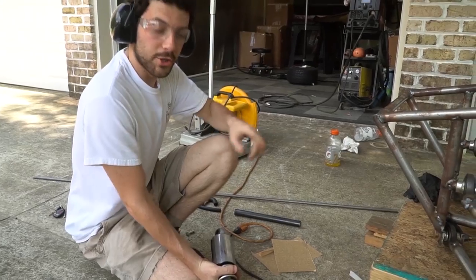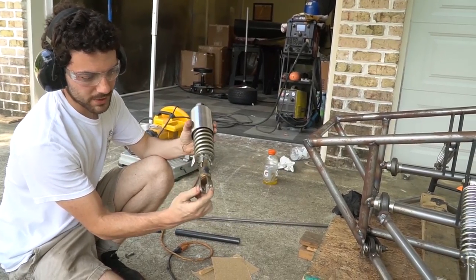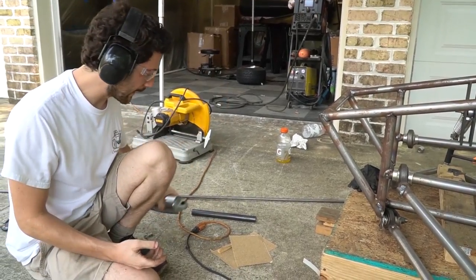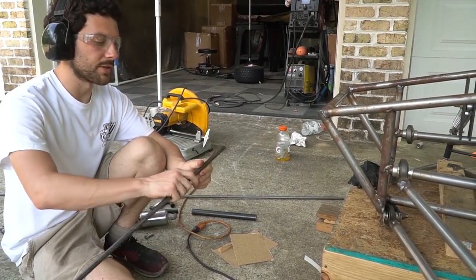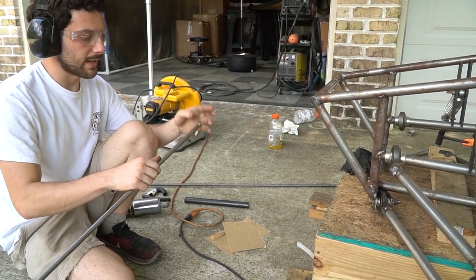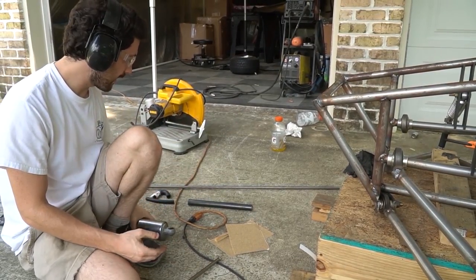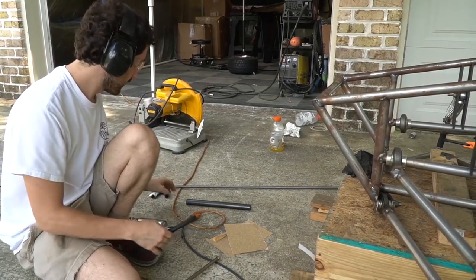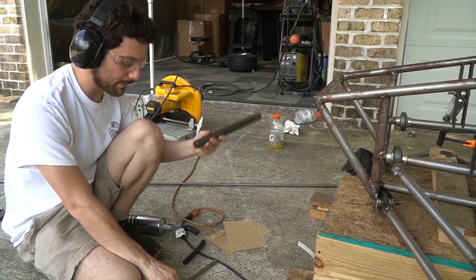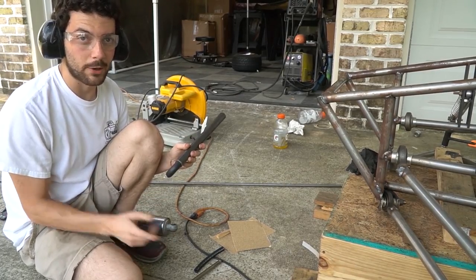So Ike has been working on the front shock mounts, I've been working on the rear shock mounts. The way the original rear shock mounts is different than the Go Power Sports one, so I'm basically assembling a bushing from scratch. I had to run out to the store and grab this pipe, and I actually had to drill it out a little bit so that our bolt would slide into it. So I'm gonna cut a piece to fit in between this shock. Then I went to the auto parts store and got some fuel line and also this hose, because this hose seemed to fit better. That's gonna slide over this pipe, and then I'm gonna have a third pipe slide over the hose. And that's gonna be our bushing and lower shock mount for the rear.